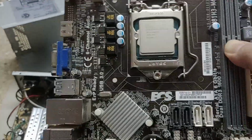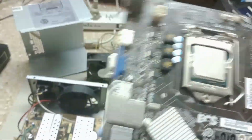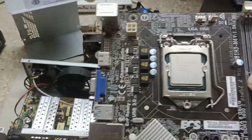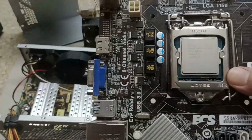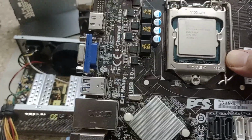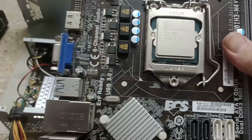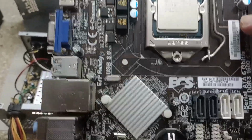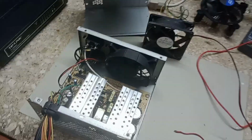Okay, I found this in the street, so not much to worry about, but it's kind of frustrating not to have another CPU or board to test the parts. In my opinion, I suspect it's the processor, because if you remove the CPU, the motherboard turns on just fine. Obviously, it doesn't work. And nothing gets too hot, it keeps warm. Yeah, I'm suspecting the CPU a bit more than the board. But again, sadly, I don't have anything to test.